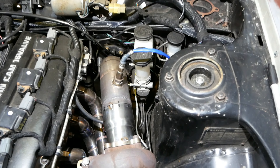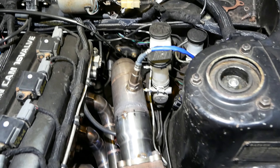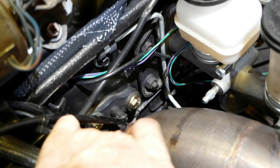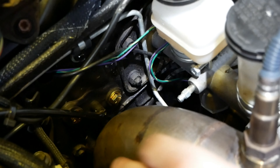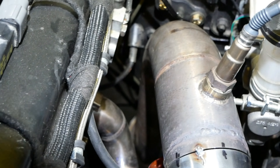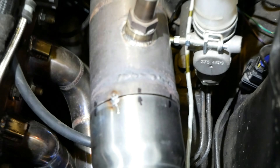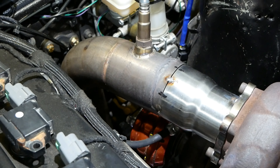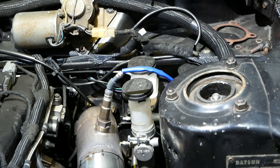Here's a view looking straight down. If you look right back here, you've actually got decent clearance to the throttle cable, and looking straight down in there, it looks like this thing is situated happily between the pitman arm and the trans bell housing. Actually, we gained a little bit of clearance to this brake master bleeder. So I think that is going to be our new downpipe. I'm going to throw it up in the air and check the fitment to the rest of the exhaust.